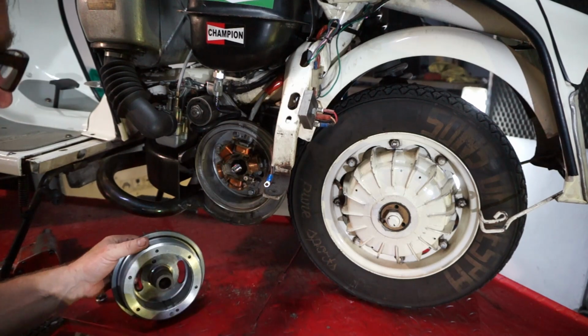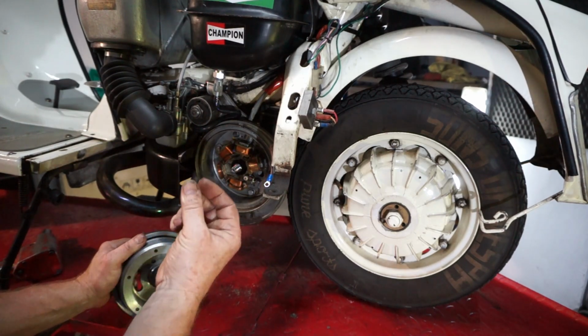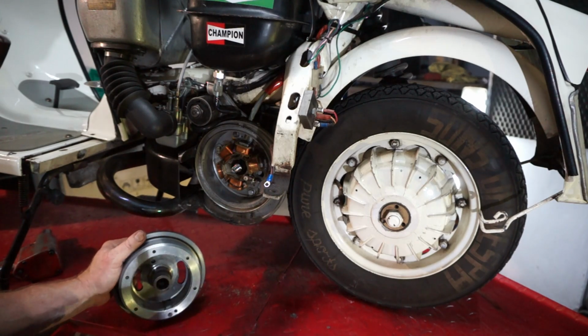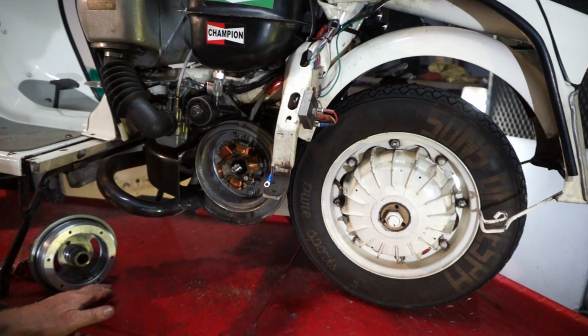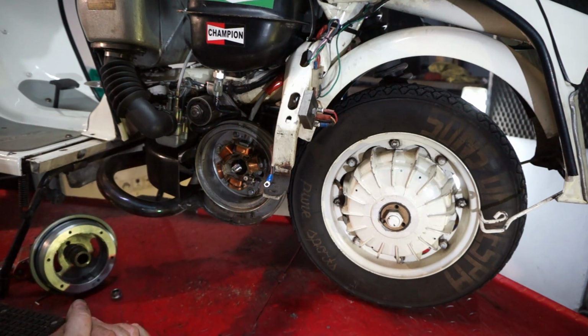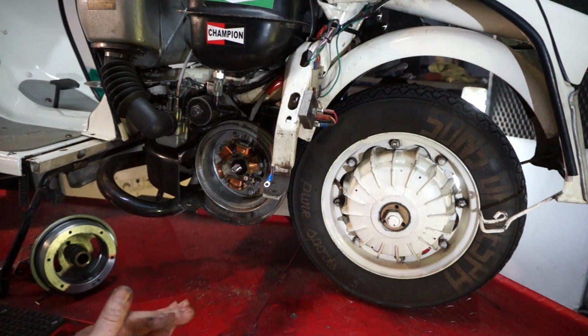It's probably that one. He's put big washers on the stator, and they're quite thick, so it's caused the bolts here to rub on the back of the flywheel. A tiny bit, hardly noticeable, but it is there. So just a few things to sort out here. We'll leave the condenser where it is. That's great. Yeah, external condenser. We'll lubricate the pad. We'll change ignition timing.